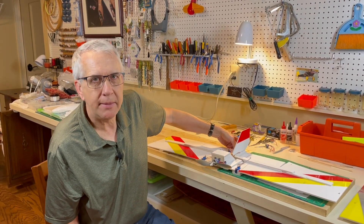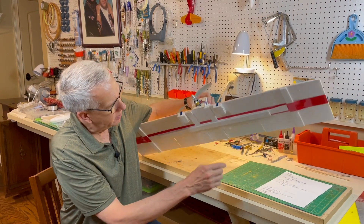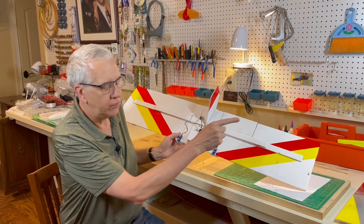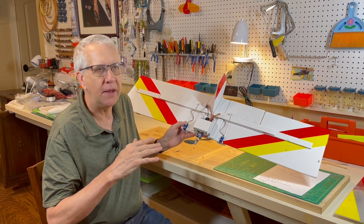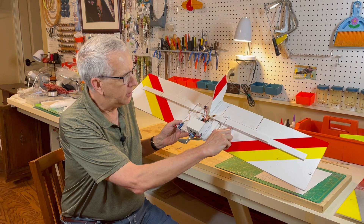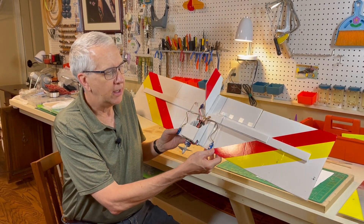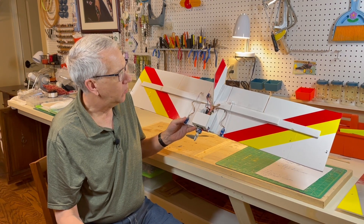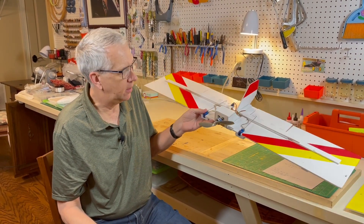So I looked at the video and said, maybe we can give it one more try. I added spars on the top and bottom of the wing so it is strong enough — the wings are not going to fold in future flights. I also reduced the throw of the elevon through the computer radio to about half of what it was, to prevent pilot-induced oscillation. I think by having a reduced throw, it will prevent me from over-controlling if it gets into that situation. There are some unknowns — the spar will block some airflow over the elevons. We'll make sure the center of gravity is located 25% of the way back and see if this improves the pitch stability of this rectangular flyer.